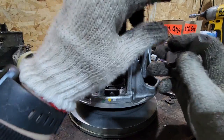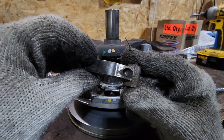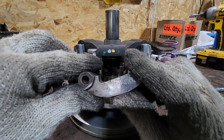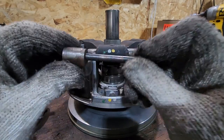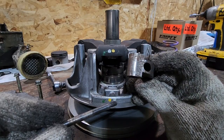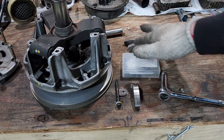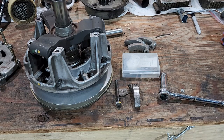Don't forget the little tiny dust washers. Let's have a look at this weight — you can see very visibly how oblong it is. For an aftermarket weight, this did not hold up well at all. By the time the pin gets to that spot, this thing is just wobbling around — that weight is just toast. Luckily I was able to find both the other aftermarket weight kit and the stock weights, so I'll be able to show you three different types of weights this week.